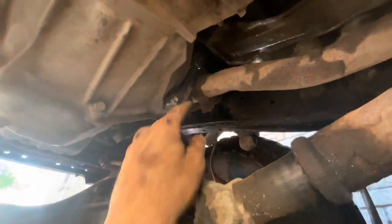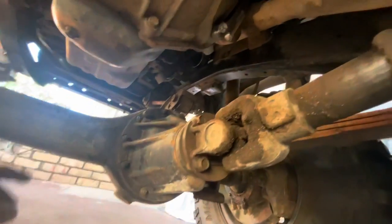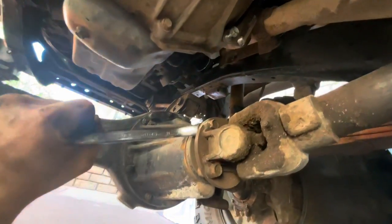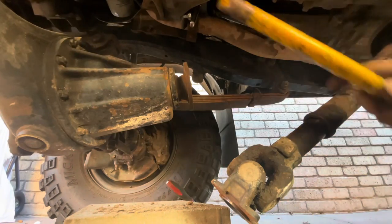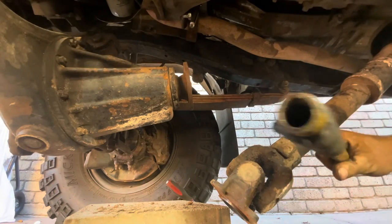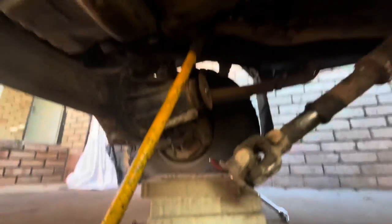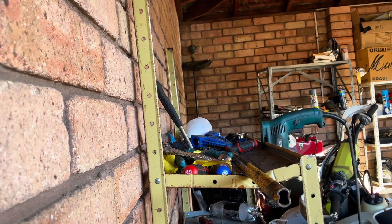Toyota said 'would you like to play a game?' — they put this bolt up here, and if you pass that you're on to the final bad guy up there. What kind of sick engineering department do they have at Toyota? I managed to get the socket on there but I can't break it with my hand — I need a breaker bar but something's in the way. Got to get this off first. This took me a whole day to get the tailshaft off when it was being a pain. Here's my plan: that's the spanner, I'm gonna make it longer with this piece — it has a hole in one end so I'll slip that over the handle. We're a bit long so I'll grind a bit off and then I should have good leverage to get that bolt.